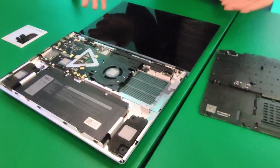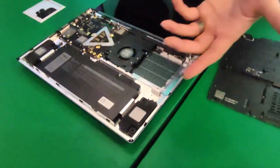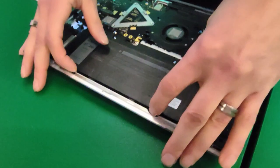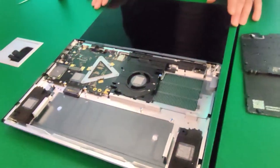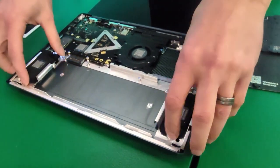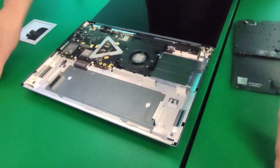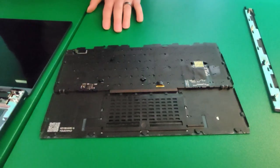If you're familiar with a Dell desktop or server, you see blue. Blue designates that you can remove items - we continue that language here. First thing I'll do is take out the battery - just slide that up, there's the battery. Next we'll take out the speakers - there's your left and right speakers. Take those out and you can see there are no wires; we have these little connectors that interface with the keyboard.